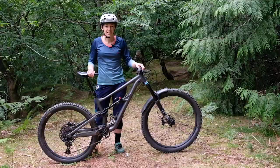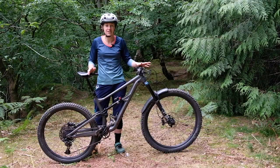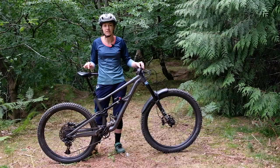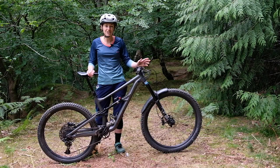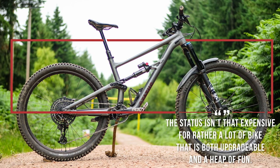That said, the Status is really fun and has become my daily ride. I'm really enjoying the mullet setup, and I've got some tweaks I want to make. I've got some 165mm cranks — 5mm shorter than the stock ones — going on, and then a new rear mech, which will hopefully silence some of the chain-slap noises from the SRAM NX. If you're in the market for a hard-hitting enduro bike that has a little bit of jib-life character, and you want a mullet or you're interested in trying one without breaking the bank, then the Status is a good one to look at. It's got geometry specifically set up for the purpose and is well worth a look in the long-travel bike category. It's not that expensive for rather a lot of bike that is both upgradable and, as I've said, a lot of fun.